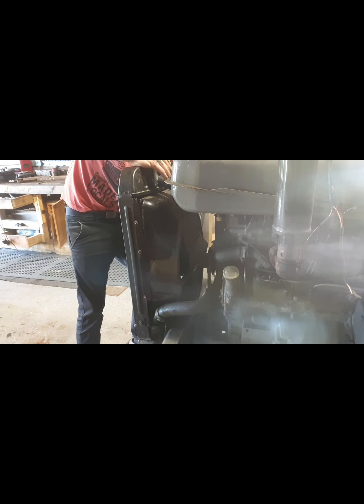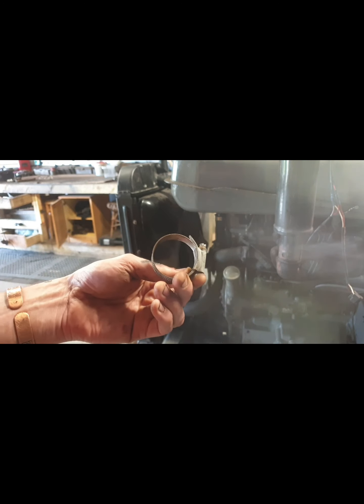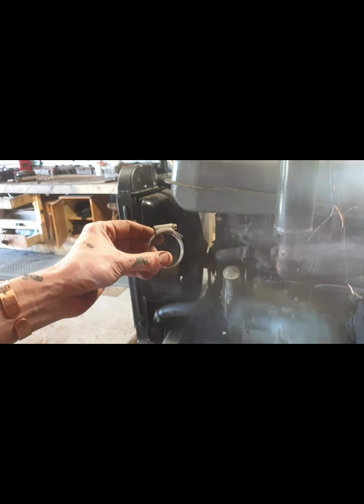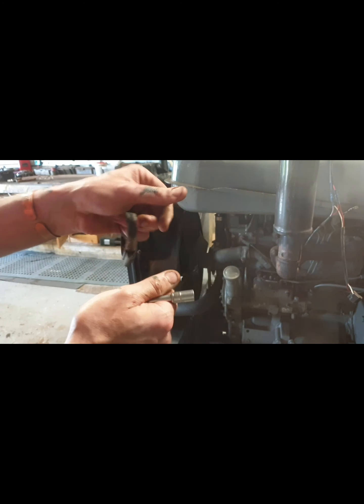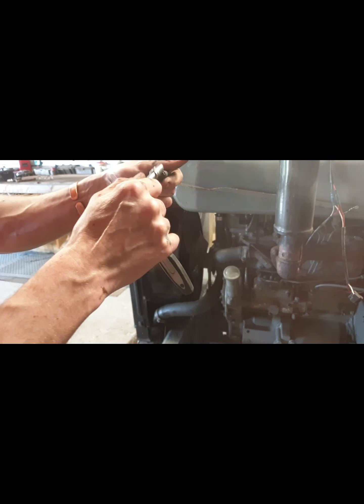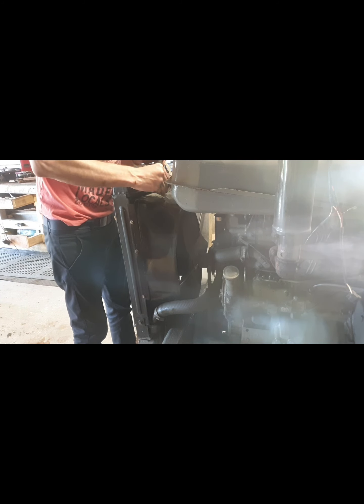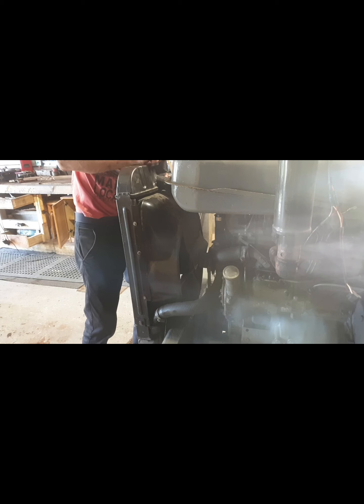That looks good. Clearing the fan belts now. I remembered I'm going to change this jubilee clip because it was really stiff — it just wasn't tightening up great and it wasn't loosening great. So I'll fit a nicer one to make sure it's going to seal up the hose. I usually use a 7mm socket on those and I find it just tight. If it's a good quality one you can use a socket on them, but bad quality ones — when you tighten them up with the socket they just skip. That's what was happening with that one. Now is the time to be doing all this.